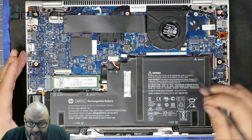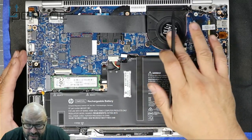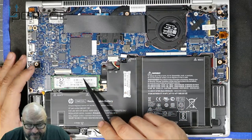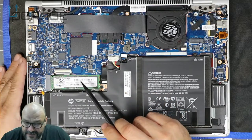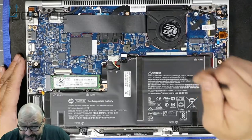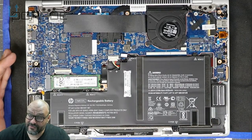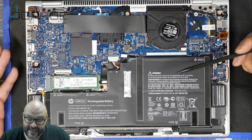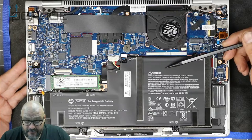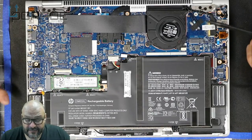To remove the battery, remove a couple of screws, but unplug it first. Any time you're going to make changes, always unplug the power first. Here's the 512GB SSD. The RAM is built into the system — you're not going to be able to replace it at all, so when you first buy the computer, make sure you set it to at least 8 gigs of RAM, or higher — 16 to 32 gigs max. Most of the time you have to call in to get the higher RAM options.